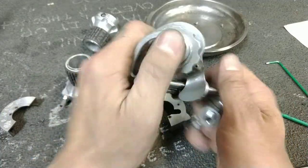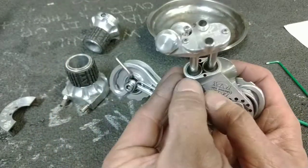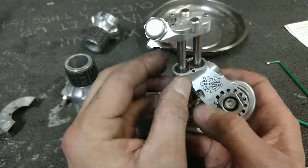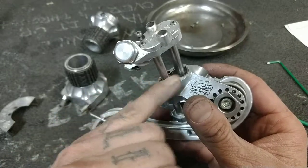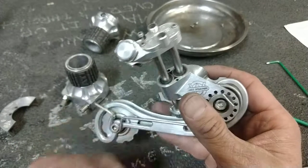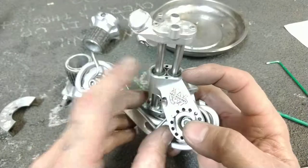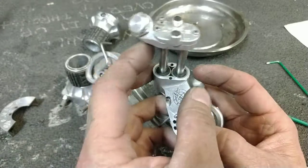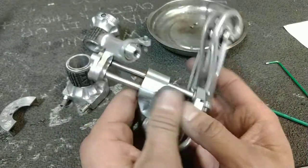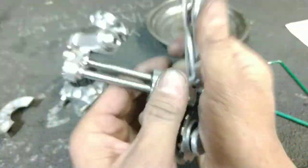When you see something with teeny little fasteners, these are sealed, right? But mountain biking's real muddy. And I can imagine all kinds of schmoo getting stuck to the shaft and just traveling through there. I mean, this is basically like a suspension fork. You have some seals there, but there's no wipers. There's just a rubber. It's like a 2RS cartridge bearing. It's going to get absolutely knackered in there. And, you know, even now, I don't know if you can hear that. It's very, very, very rough.